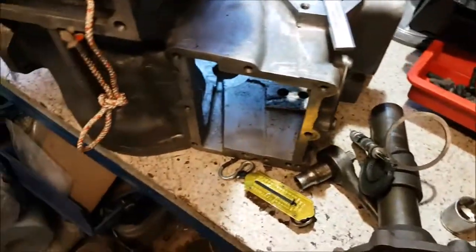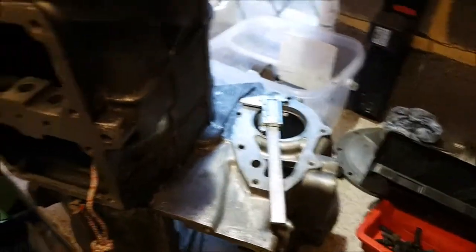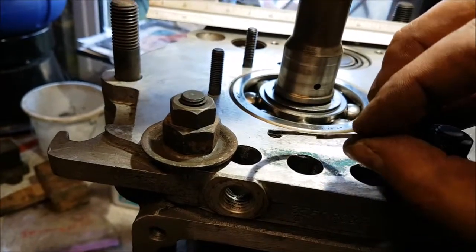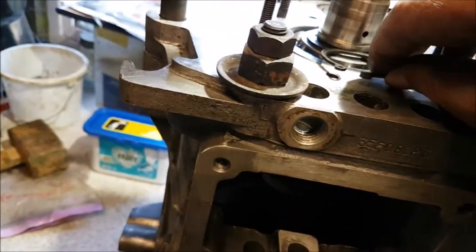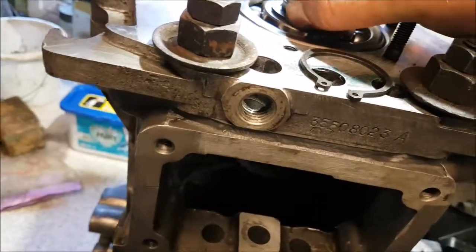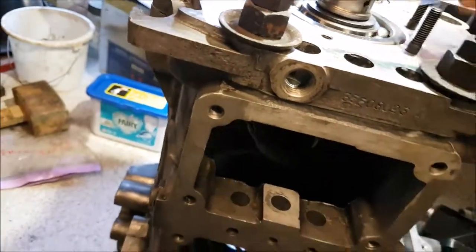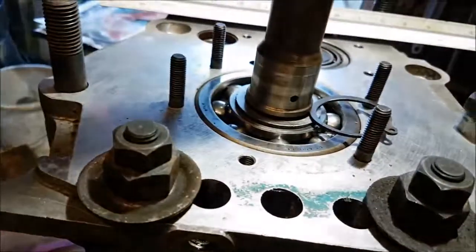Okay so 2.21 millimeters — I need something a bit fatter than that but not so fat. I'm going to get a selection of shims and go see what's available. I also need to order a new circlip — the circlip that goes onto the input shaft goes around here and holds the input shaft onto the bearing. The circlip is all over the place, you can see it's bent and mangled, so I'm not going to trust that. I should also check the tolerances of this shim here — I'll measure that one as well with a feeler gauge, by putting the circlip into the gap and measuring the distance between it and the shim underneath.